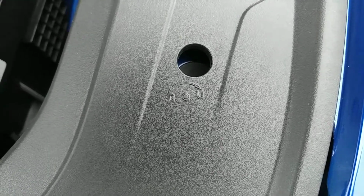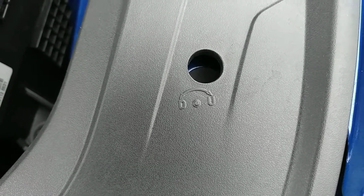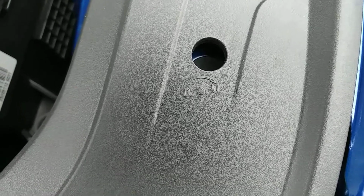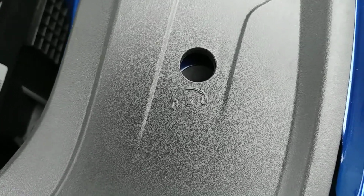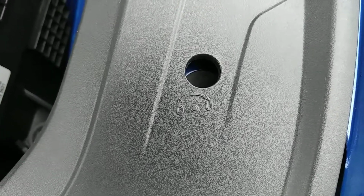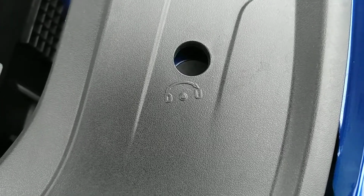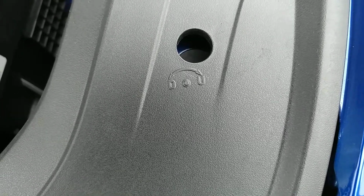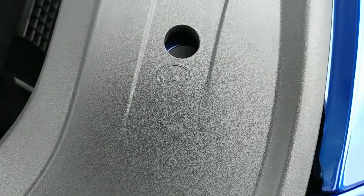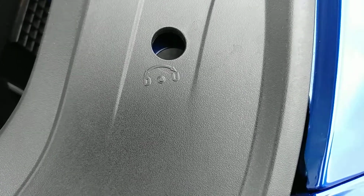There are tons of videos on how to aim your headlights, like on the garage door, maybe on a building, a flat wall, whatever. And articles, really good ones. Check those out if you want an idea of where your low beam cutoff should be. I can tell you this one was only off by not even an inch. I probably didn't even raise it up an inch. But believe it or not, just raising your headlights up a quarter, half an inch, especially if you're pointing in the ground, makes a huge difference with getting light down the road. You just want to get that light down the road and not point it in the dirt.